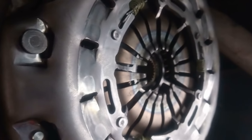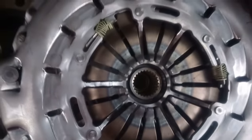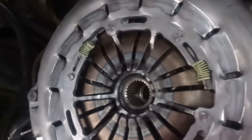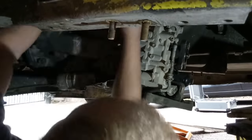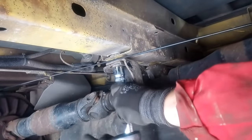This is the new part ordered by Cheesy the mobile mechanic — no idea why his name's Cheesy, but I ordered it through him because he actually knew what he was talking about. You can see the splines are way further down. As we were tightening it up they just closed in as they should — the area that sits against the friction plate was a whole five millimetres thicker. This explained why the pressure plate splines weren't going down as we bolted it on, which was pushing the thrust bearing too far backwards and causing the fault. This job damn near broke me. No man should take his gearbox in and out seven times. Seeing those splines close down was a massive relief — knowing this was the last time we were putting the gearbox back in.